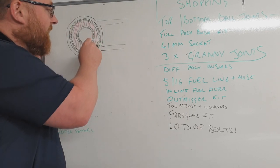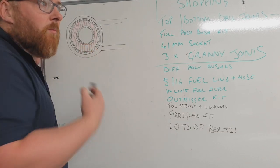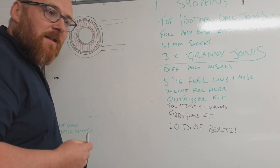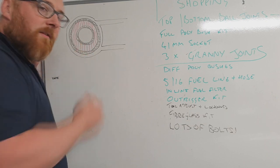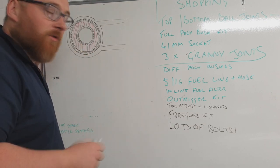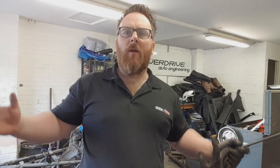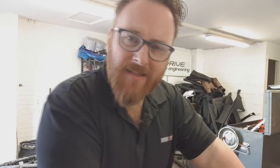In the middle there will be another smaller metal tube that allows the bolt to go through and bolt up, nipping up the whole joint without stopping the rubber. So how to get these out - this outer ring is pressed into the wishbone or whatever joint it's in. That means it's an interference fit; it's not going to fall out the minute we loosen it. There are a wide variety of methods, often preached as being the best online, for removing bushes. It's time for us to debunk, improve and literally bench test all of these.